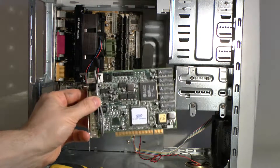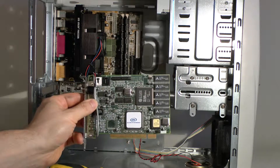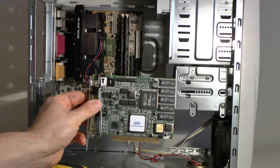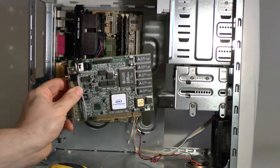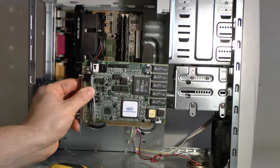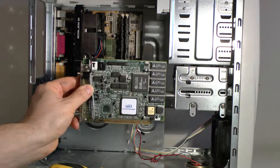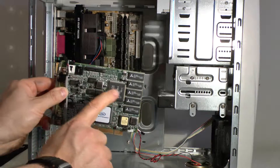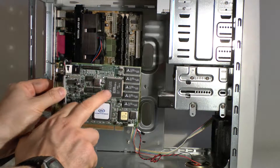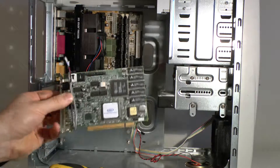The next thing going into this machine is this particular card. It was originally in a Dell machine linked up to a Matrox Millennium video card, and it basically enabled DVD playback. Back in the day, DVD playback on PCs was very hard to do because the hardware didn't allow it, and there were copyright issues preventing playback. So they came out with these video cards which had a cinema chip on them — this is a C-cube cinema chip. This chip was an add-on to your original video card.